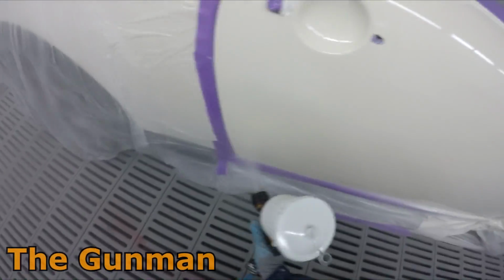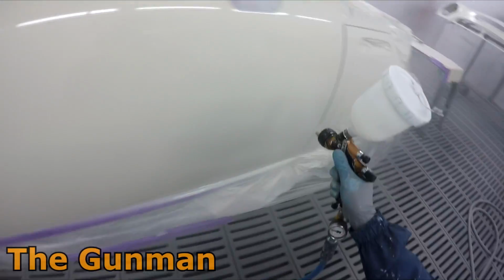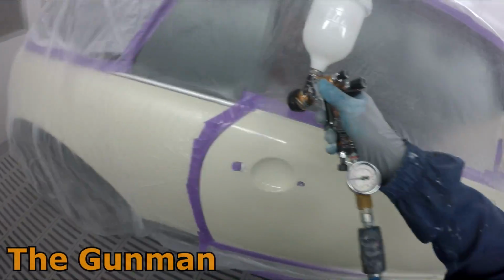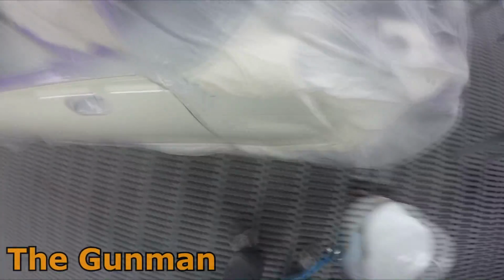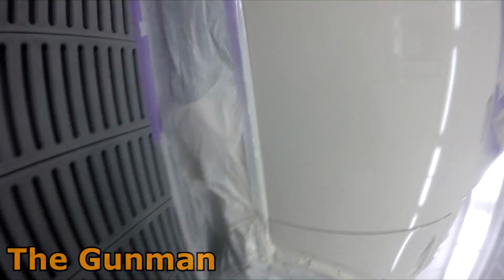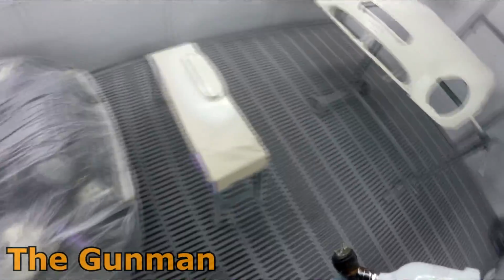And look, I'm not going to lie, you can see that blend in this booth. After I got that clear coat down, it looks like where my base coat color is, it's lighter, and the back of the door where I've just put in clear, it looks like it's got a touch on the yellow side. Now, I do have some footage of this in the detailing bay, not even in full sunlight or anything, but even under different lights, it looks fine. You cannot see it at all.